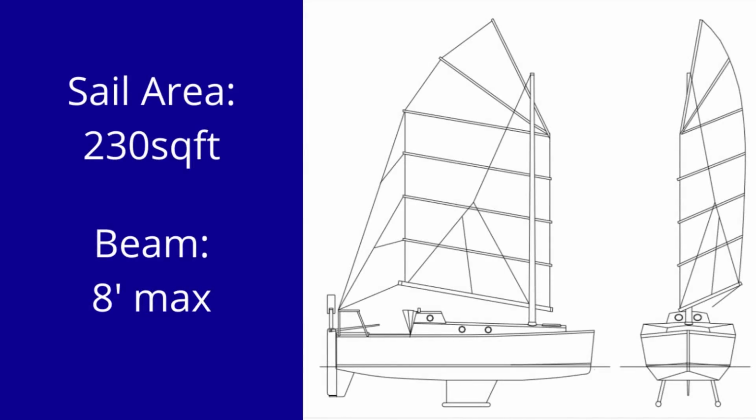The second reason, which is probably fairly obvious to people, is that the boat itself will stand on the bilge keels. So you don't really need a cradle. So when it comes time to clean the bottom, you can just sail up gently onto a beach, let the tide roll out, clean the bottom and paint the bottom, and then wait for the tide to roll back in and float her again. So you don't have those expensive yard time and maintenance to worry about.